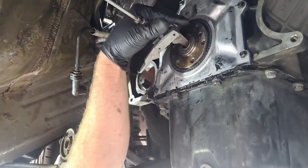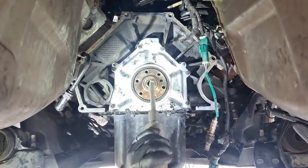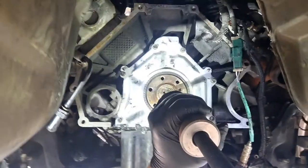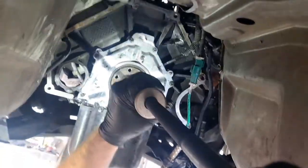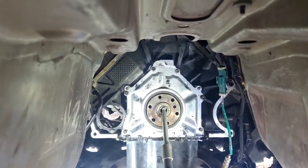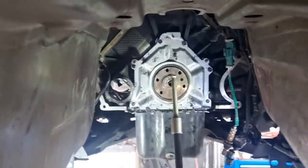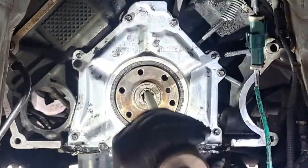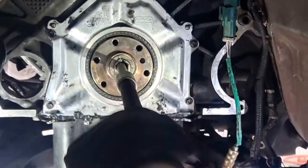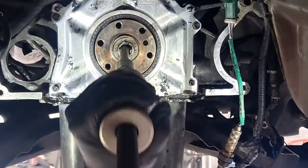Okay, Liam, you pause. Alright, if this one fits, this one might not quite fit. We might have to bust this bearing out in pieces to get this one in. Ready? I'm just gonna bust it apart. I'll pop this one in. I'm trying to go in right now. Because I gotta catch the lip. But this is a stronger slide hammer, so if I catch the lip, we'll be able to get it out. Then we'll clean all this debris and junk out after. Okay, ready? Hey, nobody get hit by this thing.